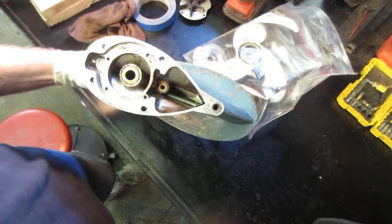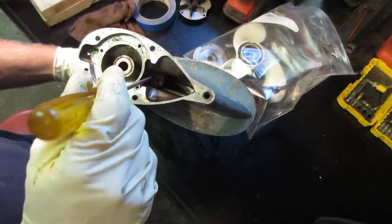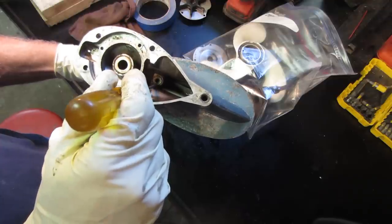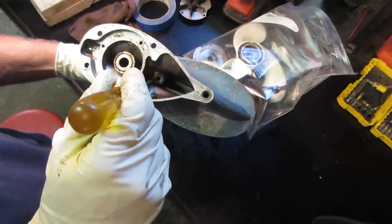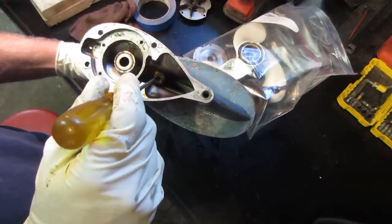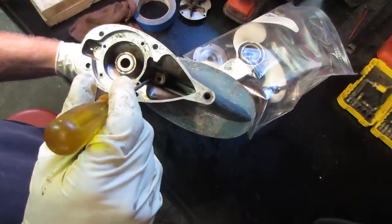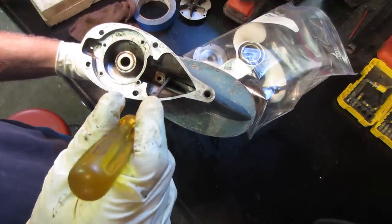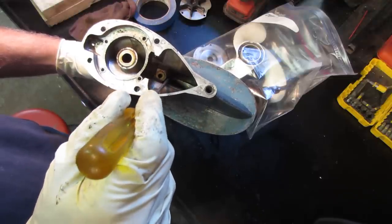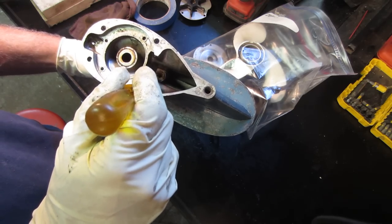So the one part that's an issue is this is where that shift rod goes through, the one we just kind of pulled out of there and cleaned up. So there's a brass plug or bushing on top. Under the brass bushing is a rubber seal and, like, I forget the name off the top of my head again right now, like a neoprene. It's not neoprene, it's a semi-hard washer of material. Leave it at that. The problem is getting this out.